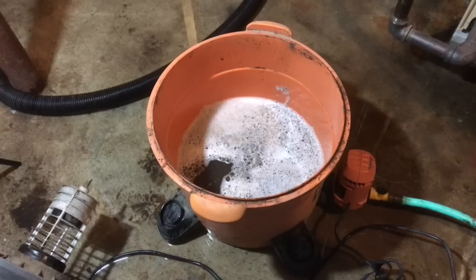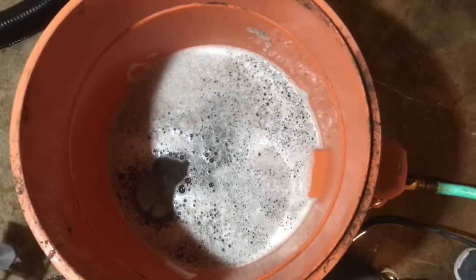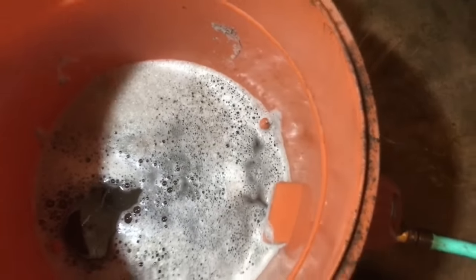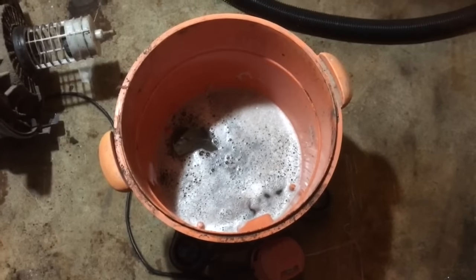I like to take the top off while doing this so you can see inside. When the water is at a low level, shut the pump off so you don't burn it out — it only takes a couple seconds to drain down. As soon as you get to the bottom you want to shut the pump off, then start vacuuming again. That's pretty much it — that's all you need to do to clean up water with this wet shop vac. Hope you like the video! Leave a comment, subscribe, give us a thumbs up, share with a buddy, and we'll see you in the next video.